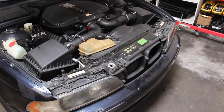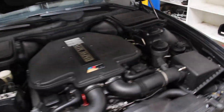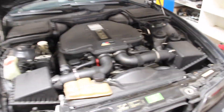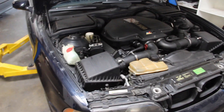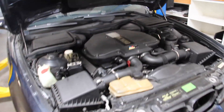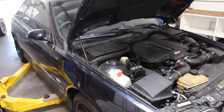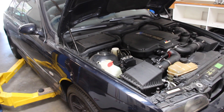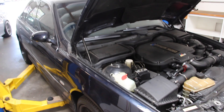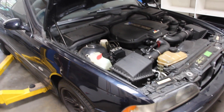Alright guys, that is it. Torque those bottom 13mm nuts to 16–17 lb-ft and you're done. Put the underbelly tray back if you have one, lower the car, and do your general maintenance while you're under the hood — check your fluids, check your filters, the basics. Motor mounts should be less than two hours total; the trickiest point is getting the socket on that top nut. Thanks for watching — leave any comments below. You can also send me an email at ryan@e39source.com with any questions or parts inquiries. I do sell parts from used, second-hand wrecked cars. Thanks for watching, and we'll talk in the next E39 Source video.